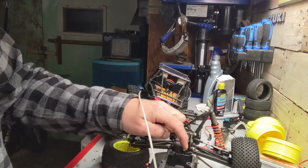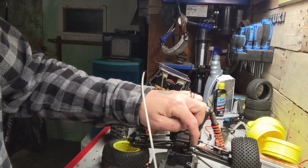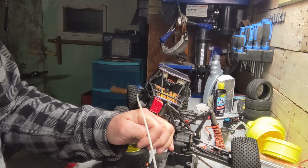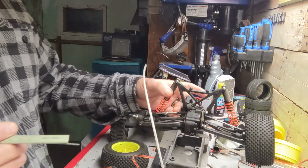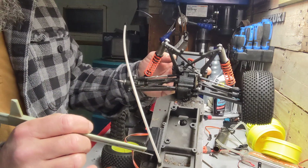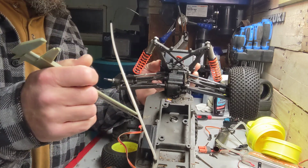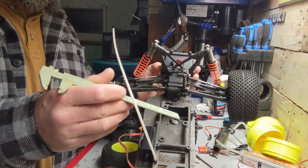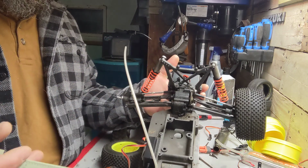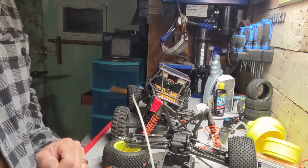It has to be a drone battery. I'm going with a 3-cell LiPo drone battery in here because the box is so small. I was going to cut it back behind the servo, and I decided not to. And so I was going to cut it here and then possibly get a battery in there. And I said to myself, wait a minute. Why don't we do a 3-cell LiPo for a drone in this car? All we got to do is cut out these gas tank mounting pin holes here, which, you know, the car will never be gassy in my collection, so that doesn't bother me.